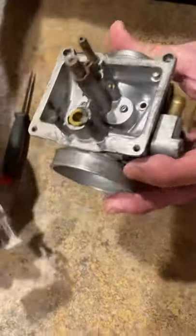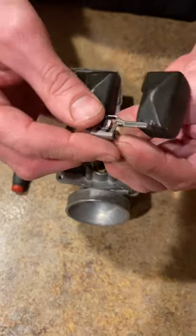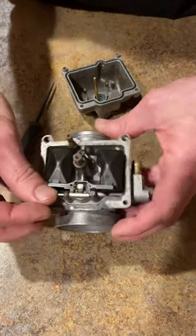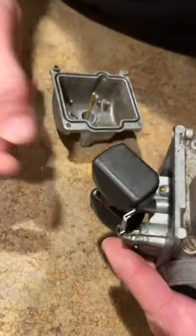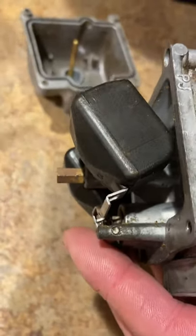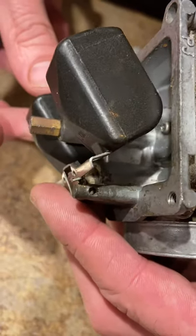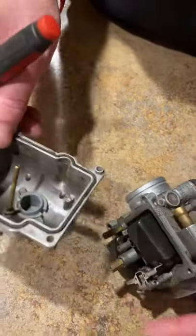I've already taken this carburetor apart — I bought this one for parts because I had a malfunction with my carburetor on my quad. Let's talk about the float. Your float determines your fuel level in the bowl. If you get a bike, open up the gas, turn the gas on, and it starts spewing gas out of every orifice on the carburetor, that float is stuck. So you can see that when it gets to a point it shuts, and then it opens. The bowl fills up and once it gets past the level of the float it goes into this tube and dumps out at your overflow drain.